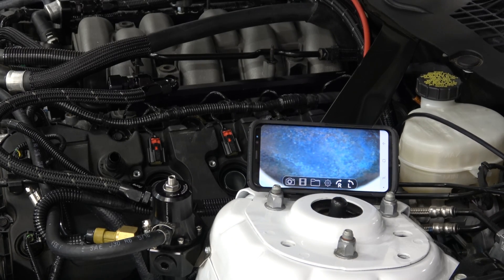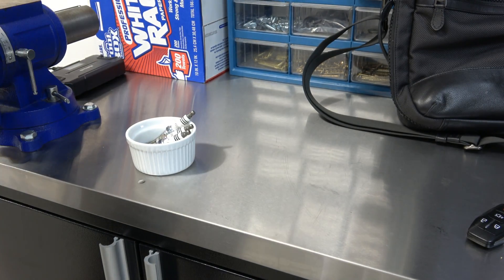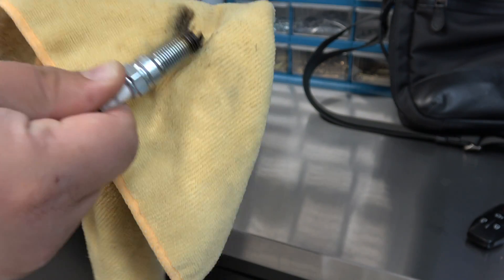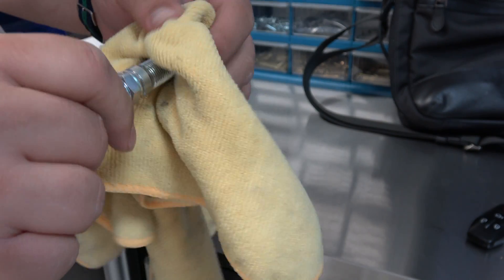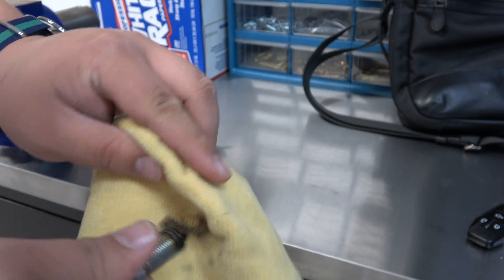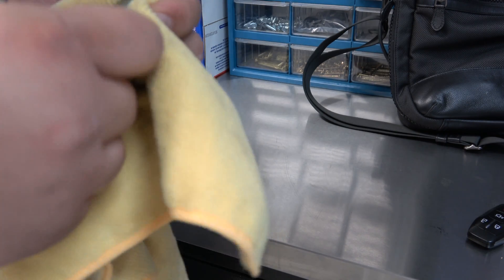A little varnish, a little bit of the orange. These plugs have been soaking a little; I'm going to clean them up — they've been pretty gross from the race fuel. That's looking much more like a normal spark plug now. Before it was pumpkin orange; you'll see it on the next set I pull.